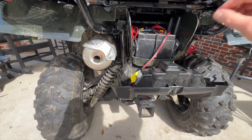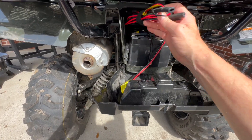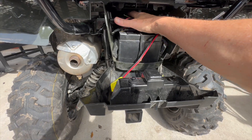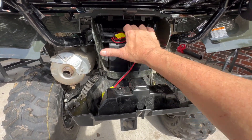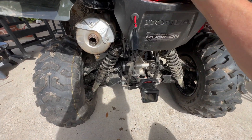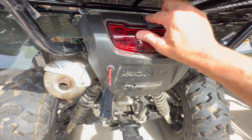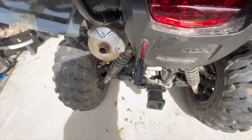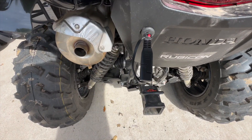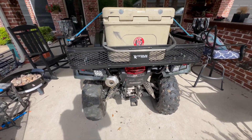Now I have two batteries in here. We installed a second battery and used a True AM battery separator, which is just a really cool little invention. We've got the factory battery connected to an isolator, which goes to the second battery. When this thing is running, it is charging both batteries. The accessories are only pulling from the second battery — not from the first battery. It's a very tight fit with the grommet, but very nice. Got a cap on it, and my accessory power is there, hooked up and ready to go.